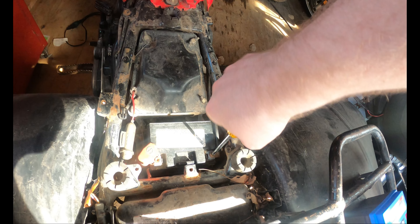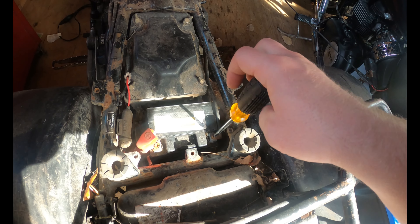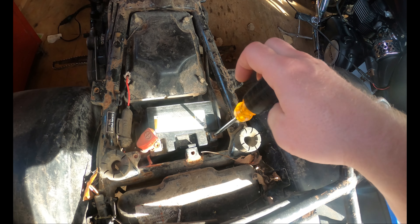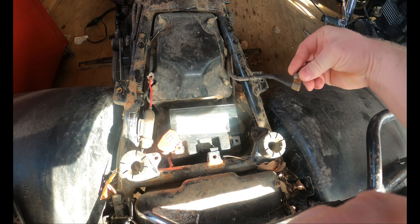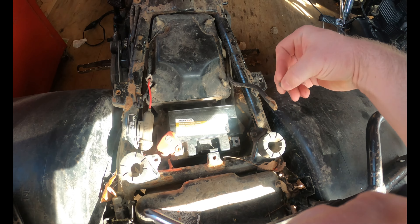You've got to take the ground off first. Yeah, this battery — if I put it on the big charger in the garage and really get it full, it'll last a couple days, as long as you keep riding it. When it sits, it just discharges. There might be a draw on this somewhere that I don't know about. We'll find out if this lithium one just doesn't last, but if that's the case I'll get an on-off switch for it.